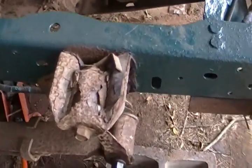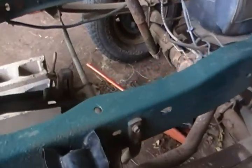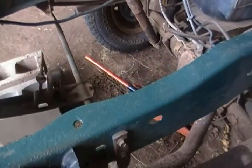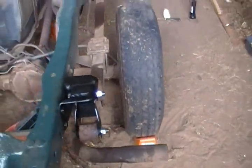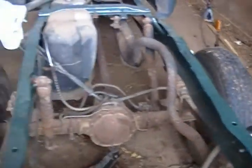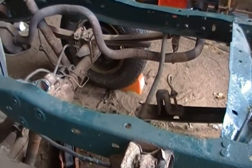In fact, you notice how this one has leaves going either direction. Well, on the side that we've replaced so far, those leaves were non-existent. They were completely rusted out. I would have given it maybe a couple weeks of hard bumps, and we would have found our leaf springs floating up onto the bed. That would have been fun.